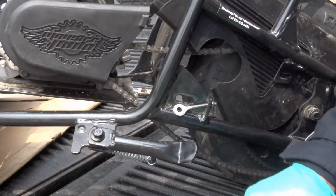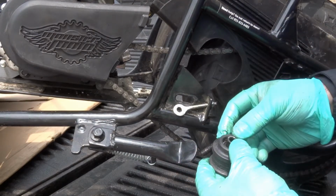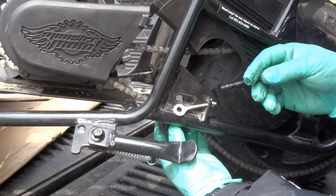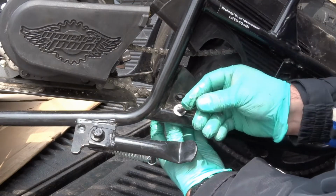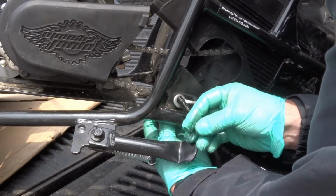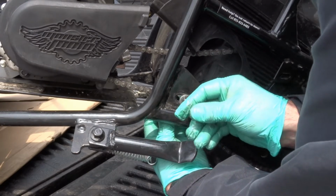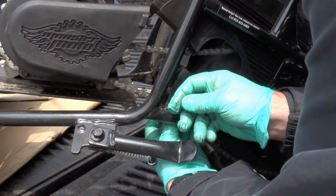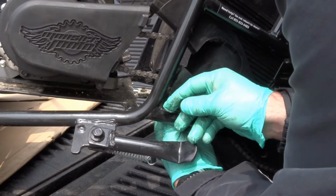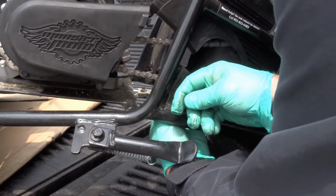And then what we do at this point, slide it under the chain, and make sure you put the bolt through the little adjuster. So this is so important, because if you don't do it like this, the tensioner won't spin, and it's supposed to spin. And that's why I was suspicious, because it just did not feel right. It seemed very, very tight, and this is why.